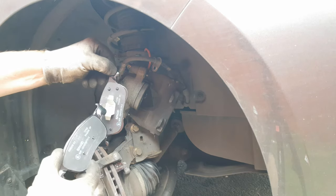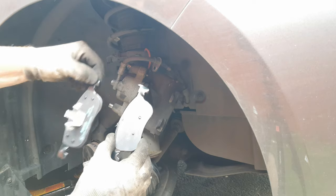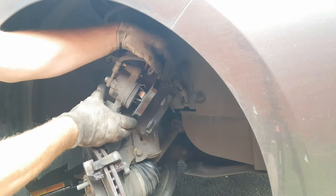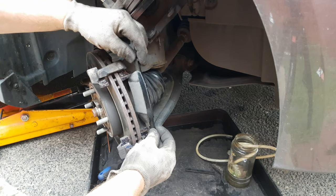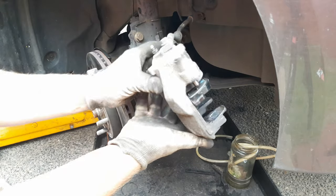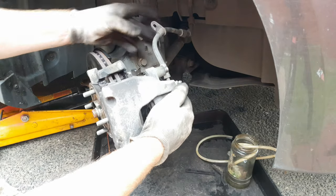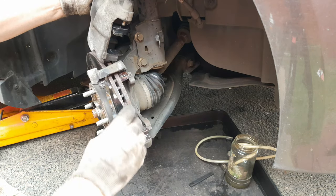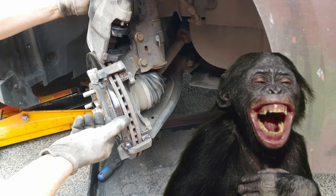A pair of pads: one has a big bracket on it and the other just two spots. The one with the bracket goes into the piston side; the one with the two spots goes on the other side. I think it's easier to just slot it into the carrier. Now bring your caliper down — make sure that the hose isn't twisted and of course make sure that you've put the pad in the right side.